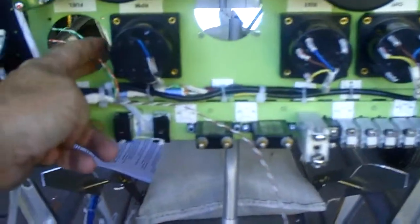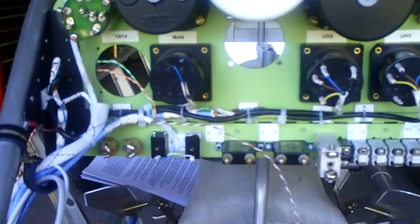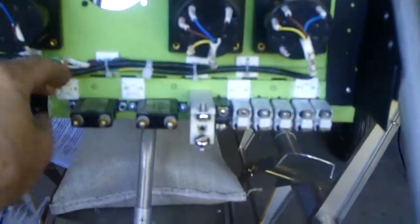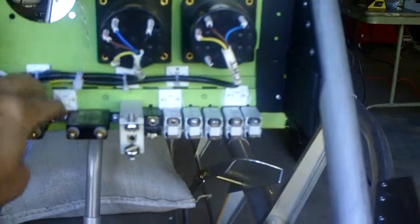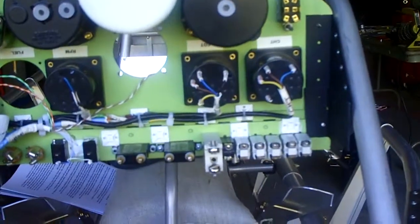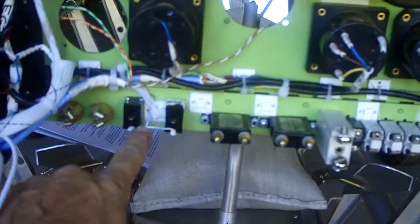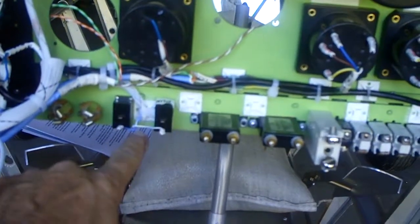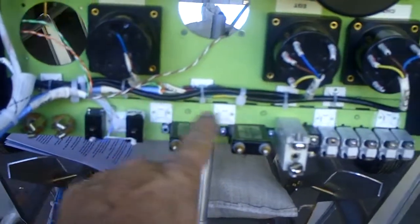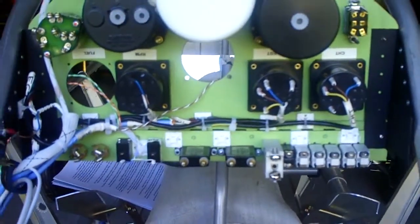I brought the wires for the fuel gauge forward through the hole until such time as I can get my fuel gauge. I also will have an electric clock up here, and that will be wired up. I have my wires for the primary and the auxiliary fuel tank wired up. This will go over here into the primary power bus.